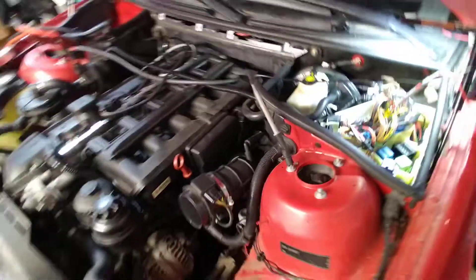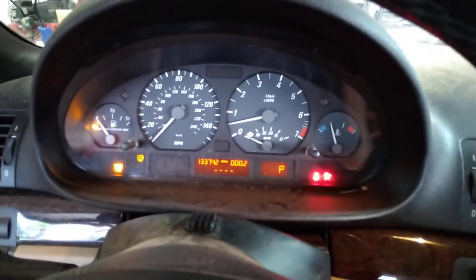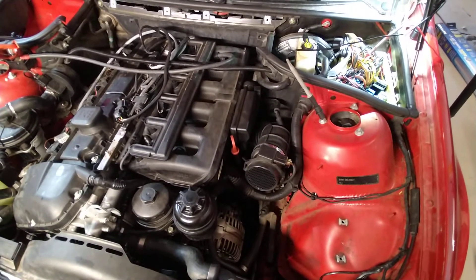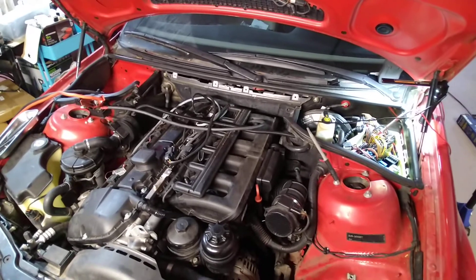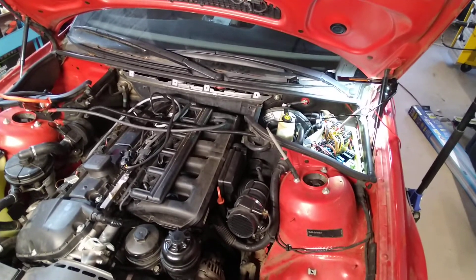Let me show you something interesting. I unplugged that intake cam sensor. Still getting the five volt reference, but when I start it doesn't hiccup. So obviously it's giving me the signal at the DME when the car is running. It seems — when I've done some testing before — to be almost RPM-based instead of time-based, or maybe as soon as the ECU thinks the engine is actually running. I've had times where it runs poorly at 400 RPMs, and then as it starts to climb in RPMs, it will do that hiccup and sometimes stall the engine.